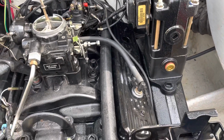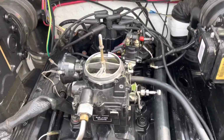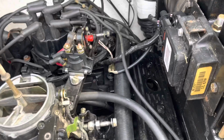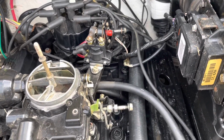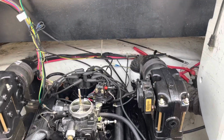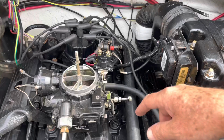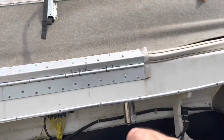So knowing the firing order of this engine, which is 1-8-4-3-6-5-7-2, so 7, 2, then 1. When you get to 2, it starts over at 1. So the way this engine works is that if I see that intake valve moving on number 7, that means the piston has already come to the top. It's in transition. It's come to the top.